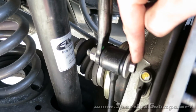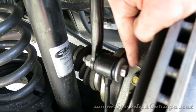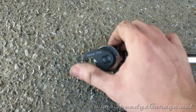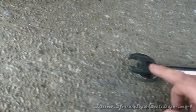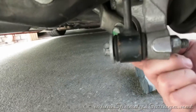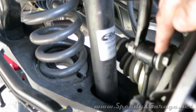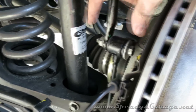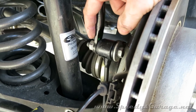Because of clearance on the top, the back side bolt sits really close to the hub and I couldn't get a socket on there. I used a crowfoot connected adapter for my torque wrench and it worked out great. Don't panic if you don't have one of these. After you tighten up the bottom, you can put a jack underneath and compress the suspension enough to give you access to that bolt. Worst case scenario, you just put a couple of box end wrenches on it and tighten it real tight — it's only 45 foot-pounds, so it's not a lot.